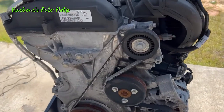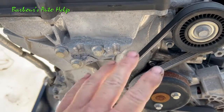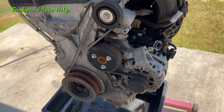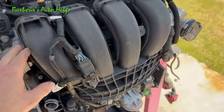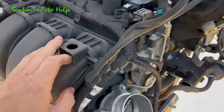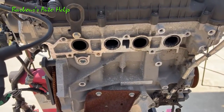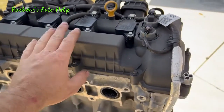Let's do a brief walk around and give you some brief history of this particular engine. This one had been in a wreck — as you can see the engine mount got knocked out. Actually the whole engine and transmission got knocked out of the vehicle. So this has been sitting for quite some time out in the elements. I'm not going to be surprised if I tear this down and find a bunch of rust inside the cylinder walls. Some things are missing — the alternator is halfway off, we got some hoses missing — but for the most part it's pretty well intact. We got our intake manifold on there with the throttle body and our wire harness, and a few things on the back like the purge valve are still present. We are missing the exhaust manifold unfortunately, but a lot of what came with this engine is still present and you'll probably glean a lot of information from this video.